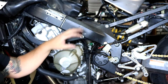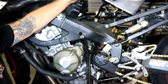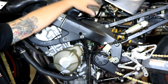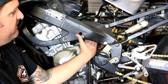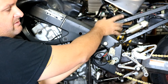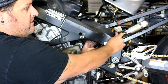We're over at the left side of the bike with the fairing, tail section, and seats off. The gas tank — I said to remove it, but we didn't want to disconnect all the fuel lines, so we have it propped up with a hammer, as everybody with a sport bike has done. The connections for the regulator on this bike are hidden behind this frame rail — there's just no way to get a good shot. If you trace the regulator — it's mounted on the left side at the back — you'll see it comes out to two connectors: the white one is for the stator, the black is for the battery.